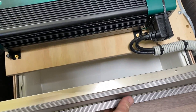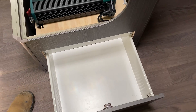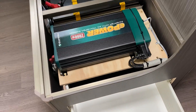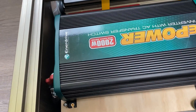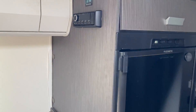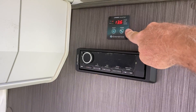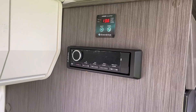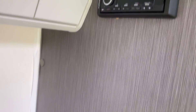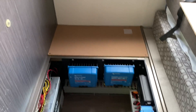Because we have very little room in this caravan, we've tried to keep as much storage as we can, so we can still use the drawers under the inverter. Hence the inverter is under a little plinth. Over this way we've got the inverter controls up here so we can turn it on and off without having to open up the cupboard.